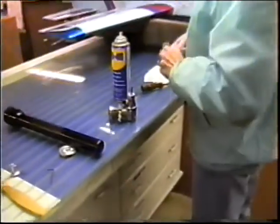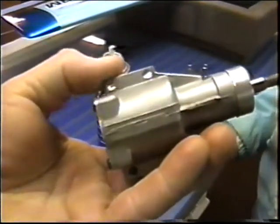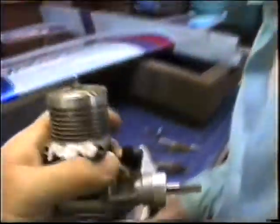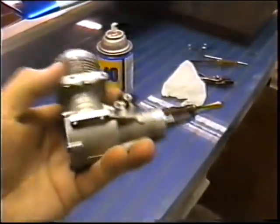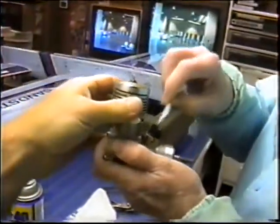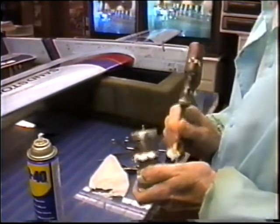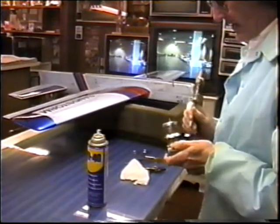All right, what we're going to do, before we do this, anytime you do any Dremel tooling on a motor, what we're trying to do is we took a motor that already has the holes enlarged, and we have to go a little bit in on both sides to get the holes to line up. Now, of course, the motor has to be in place before I cut the exhaust hole, number one. And we're trying not to use up a motor that has virgin holes in it. Of course, that's number two. And the third thing is plug them up, just stuff that down in, and make sure there's no way while we're doing the Dremel work that you can get any chips in that motor. That's an absolutely important thing, to get that packing in right. Kind of tough on compression, right? Yeah.